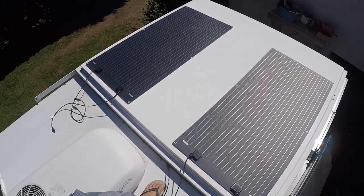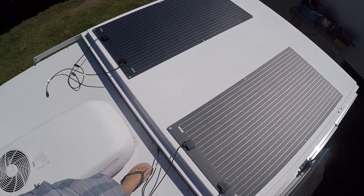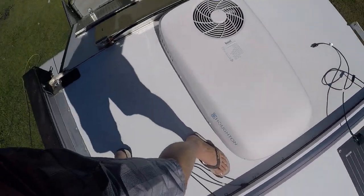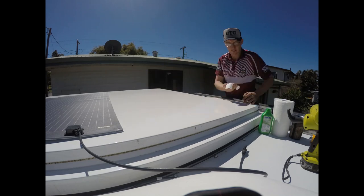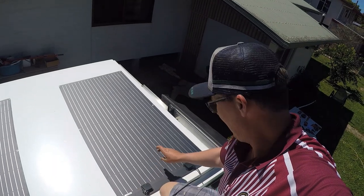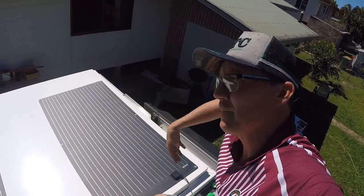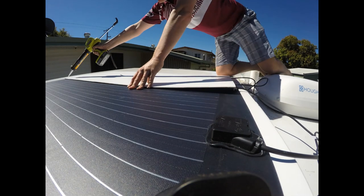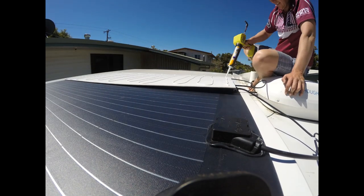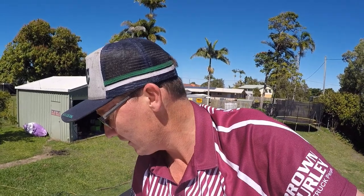So this is about the placement of the solar panels. I've got them spread apart just in case you've got a little bit of shade - sort of cover a bit more distance instead of having them next to each other. In the future I may get 110-watt panels here and another 110 where I'm standing. So clean the surface. All cleaned off. I'll put the panel here, flip it over, and apply the Sikaflex 11 FC on the back of this. But first, got to keep hydrated.